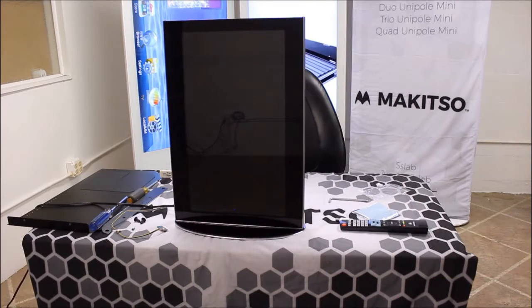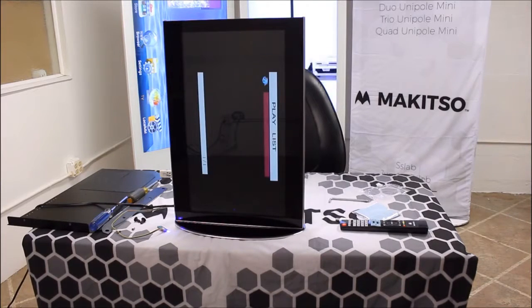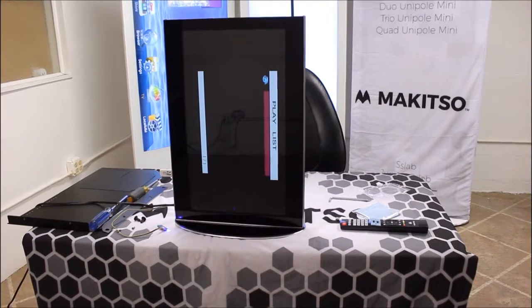And what you're looking for here is after the quick boot up, you should see the sensor flashing from red to blue rapidly for about 3 to 10 seconds. In this clip, I've already had the update on there, so it only does it for about 3 seconds. When you first do it, it'll flash for a bit longer while it's performing the update. And then the unit should boot up as normal, as seen here.